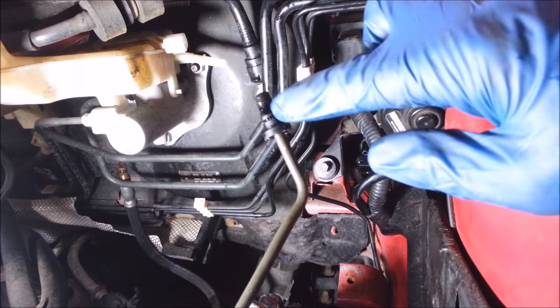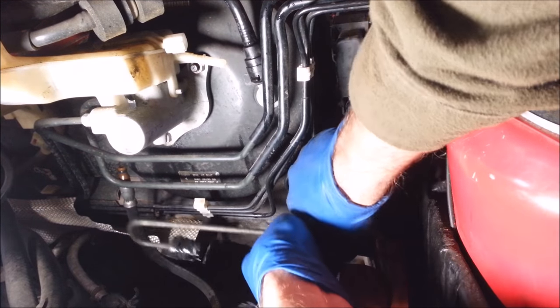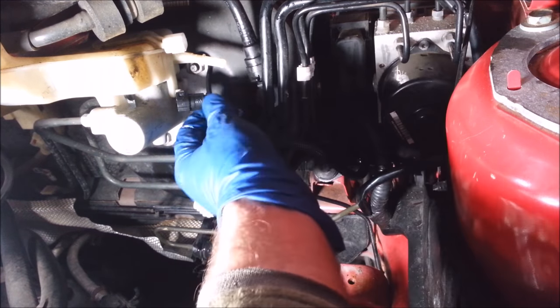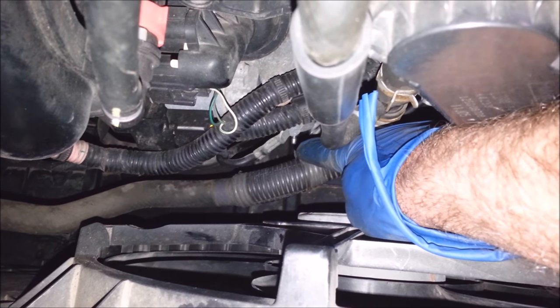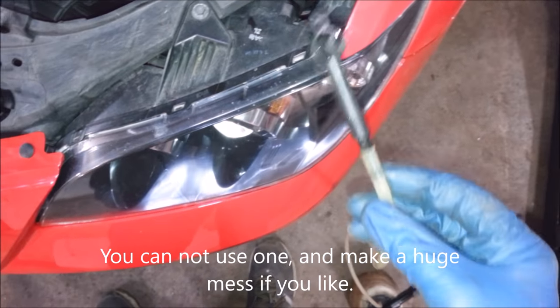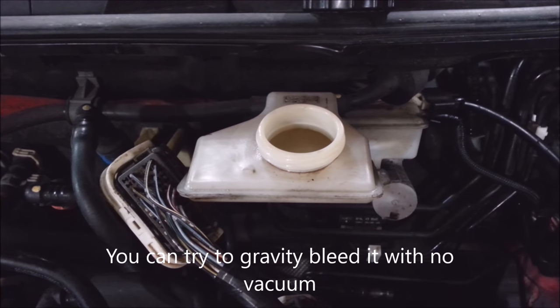For this line, I put a little lubricant on this seal — make sure it's not damaged and in good shape. These should just snap right in; same with this other line, just pushes right in and you should hear it snap. Down here at the front of the car there's a bleeder screw buried under everything — right there where my finger's pointing. That's the bleeder screw for the slave cylinder. I'm going to crack that open and use a brake bleeder to vacuum bleed it, filling the reservoir as the level goes down.